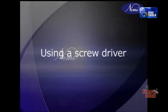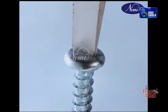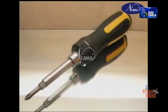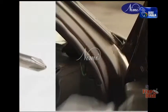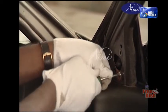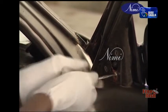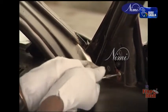Using a screwdriver. Select the correct size screwdriver to suit the screw slot. Select the longest suitable screwdriver with that size of tip. Hold the screwdriver with its axis in line with the axis of the screw. Guide the blade with the left hand. Apply a little pressure with the right hand to keep the tip in the slot. Twist firmly